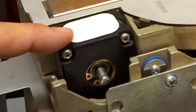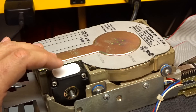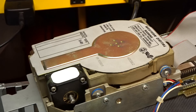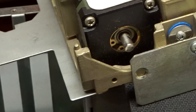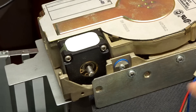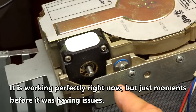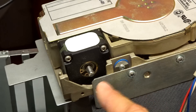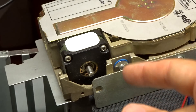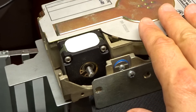This stepper motor is very similar to the stepper motors you might find in a 3D printer or even a dot matrix printer of the time. These motors allow relatively high accuracy positioning, but they are not super fast. Now let's turn this hard drive on and take a look at what happens. Take a look at this shaft here — there's a little black mark on it. The moving back and forth it's doing now is the normal startup test. During that test it would make strange noises and clunky sounds sometimes while trying to position the heads. Of course, now that I'm making a video the hard drive seems to be working perfectly, but I'm still going to show you what I'm going to do to make it work more reliably. I've actually fixed another identical drive using this method.